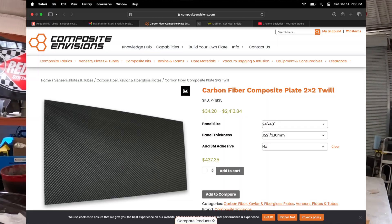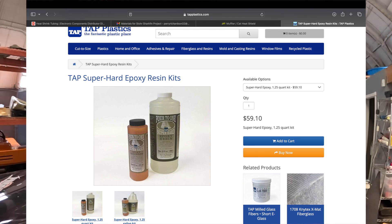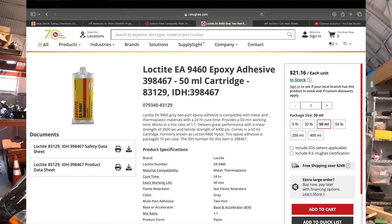I should give you a parts list of what we used to make this dorsal fin. We used a two-foot by four-foot sheet of carbon fiber, an eighth of an inch thick, ordered online. We used the Loctite adhesive that TJ recommended, peel ply, acetone, mixing buckets, sticks, paint brushes, and Bondo spreaders. Beyond that, we had a two-to-three-inch-wide roll of carbon fiber, and some wood — a couple of two-by-sixes and a big three-quarter-inch thick piece of plywood.